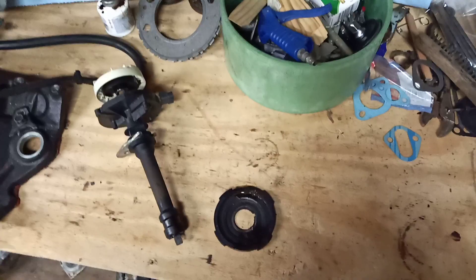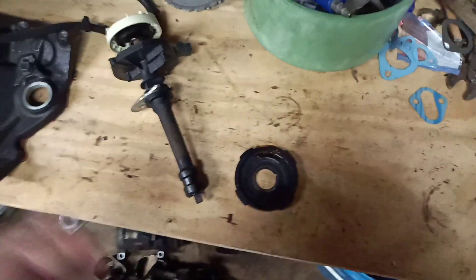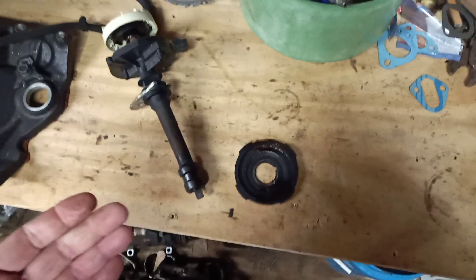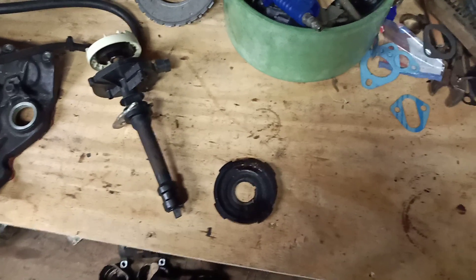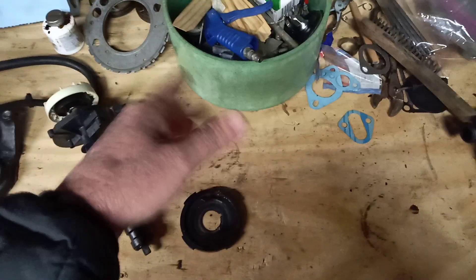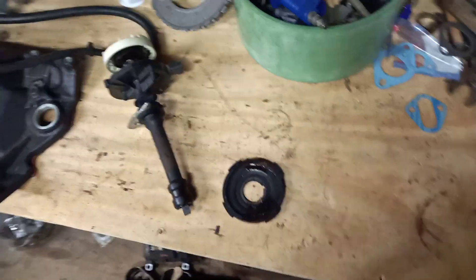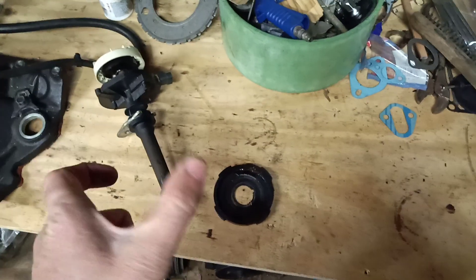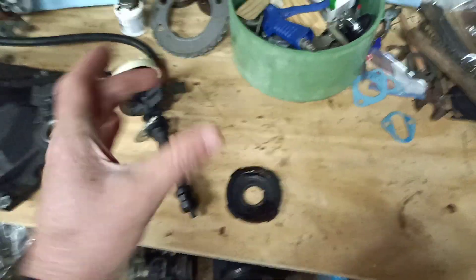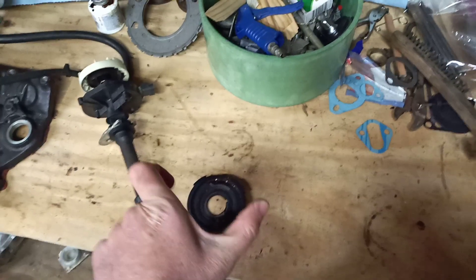The bottom line is that fuel synchronization is not timing the injector via the cam sensor or distributor rotation. Why does the scan tool give you a number to set? The Dodge engineers knew there was going to be slack and intolerances in the system — the cam gear, timing chain, cam gear, and distributor gear all wear out over time. So they give you a range of crankshaft rotation degrees within which the distributor can be rotated and the cam signal will still be considered synchronized with the crank sensor.